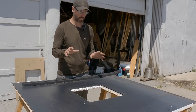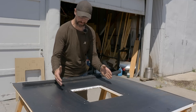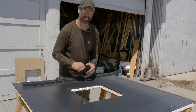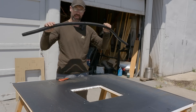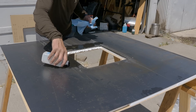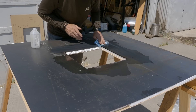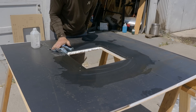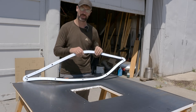Now that we've drilled our holes — the inner holes are M6s and the outer holes are M8s. For the M6s I used a quarter-inch drill bit, and for the M8s I used a 5/16-inch drill bit. Now we're going to start thinking about putting on the seal they provided. Before you do that, make sure you clean the surface very well, especially if you're putting this in the place of an old fan. Clean off all the old sealant, get back down to the bare roof, and then use something like rubbing alcohol to make sure you have a good surface for the sticky-back tape to adhere to.